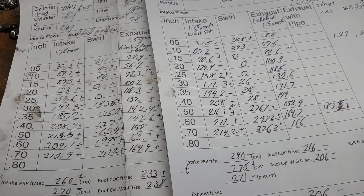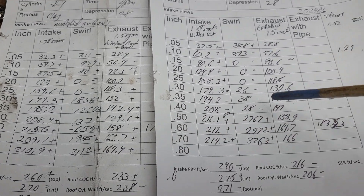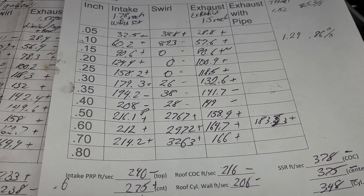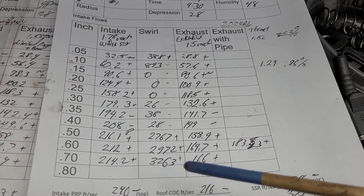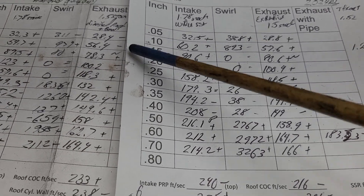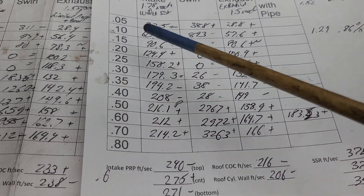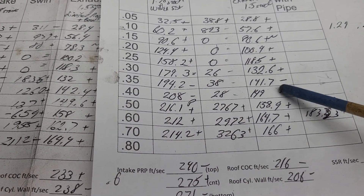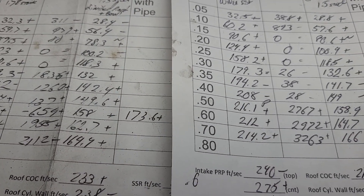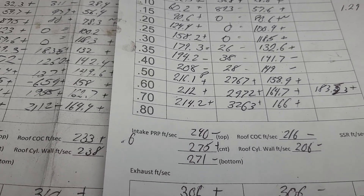As far as the radius on the exhaust - this is our last flows, which were quite good. The radius that I was able to use on that exhaust was not a big radius - it's relatively small versus the 60 degree throat cut. But we got plus, plus, plus - we had some noise here - plus, plus, plus. The pluses are very small, and then we got minus, minus, plus, plus, plus. I did it at 600 here, and a lot of my testing is going to be at 600 now because DV said we can make a 600 lift cam.